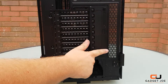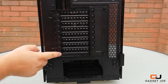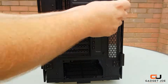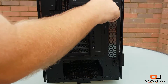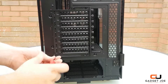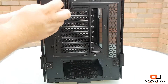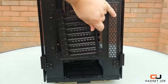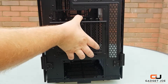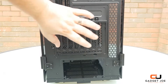You have more ventilation holes to the right and eight expansion slots in the middle, held secure with a panel. This is also one of the GT's party tricks — all you need is a screwdriver. Undo the securing panel at the right with thumb screws and remove the panel completely. Undo the two screws to the left of the expansion slots, followed by one here and two at the top. Slide the entire tray out and mount it horizontally back into position — slide it in, secure with the screws, and you have an instant vertical GPU expansion slot mount.